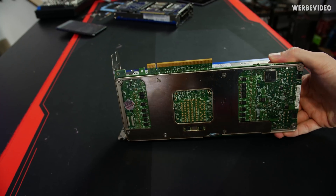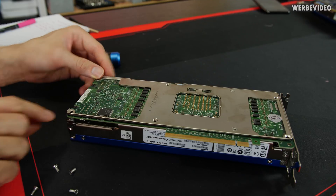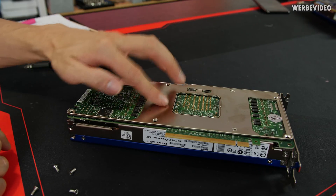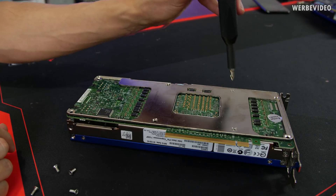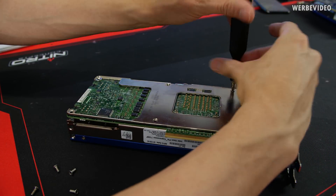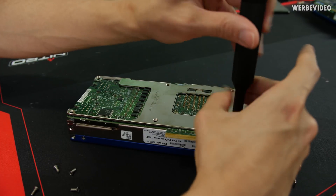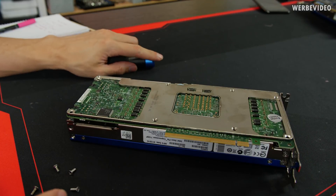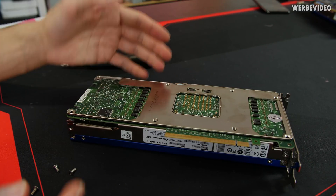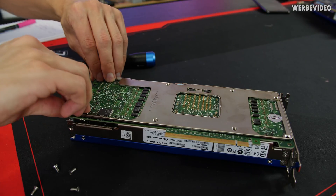Let's go ahead and open this thing. Remove the eight screws on the backplate - the backplate is mainly steel, and those parts here could be copper but I think are also steel. The backplate is fixed with eight screws in total, holding together the cooler and the backplate at once. The backplate has a very interesting way it works, something I'm surprised no GPU vendor has somehow stolen. It looks very interesting - but first let's try to remove this part.